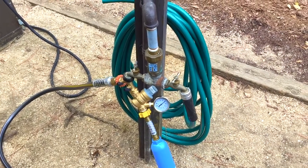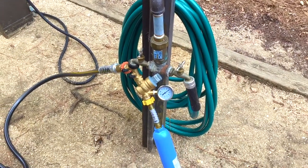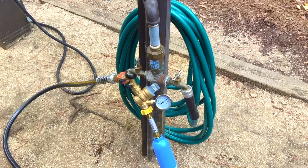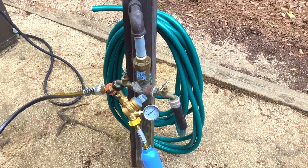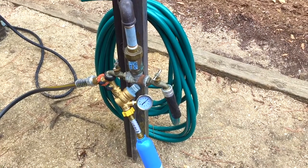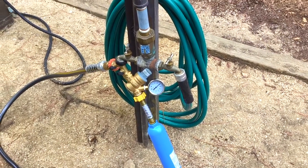Using the one with the orange threaded thumb screw there on the left, the water pressure inside the camper — say at the shower head in the shower — was pitiful. It was almost just a weak stream coming out. I was using a slightly thinner garden hose before; this one is a little bigger in diameter. But with this new regulator, it's a world of difference.